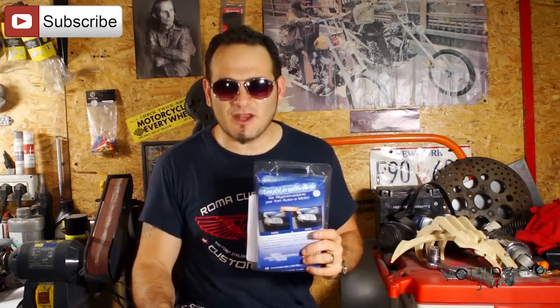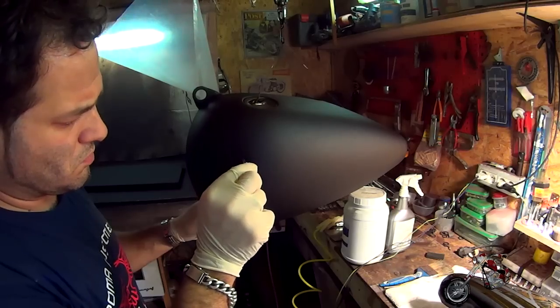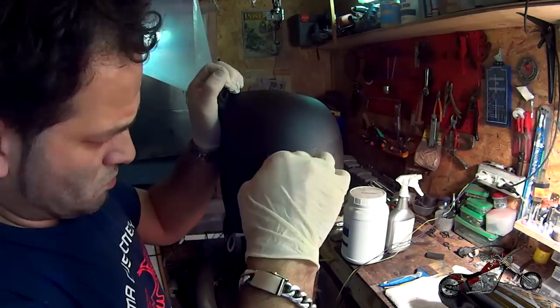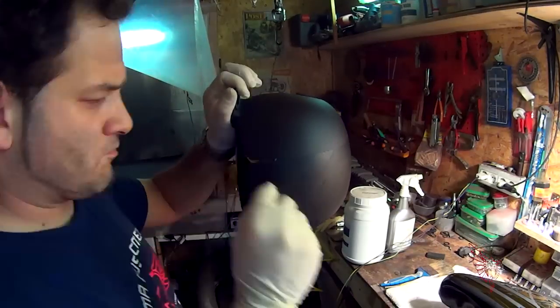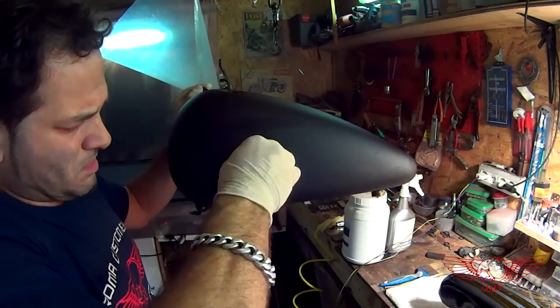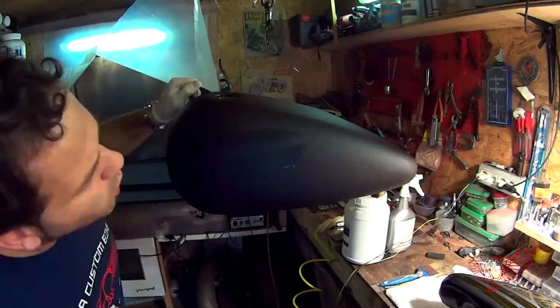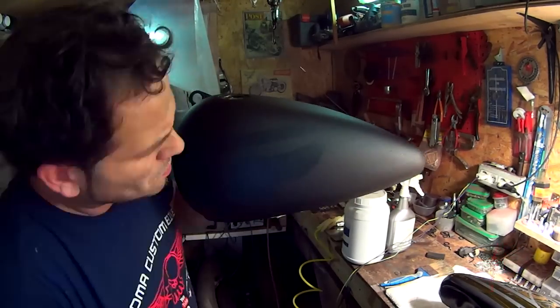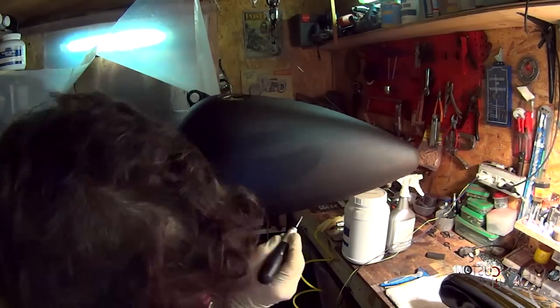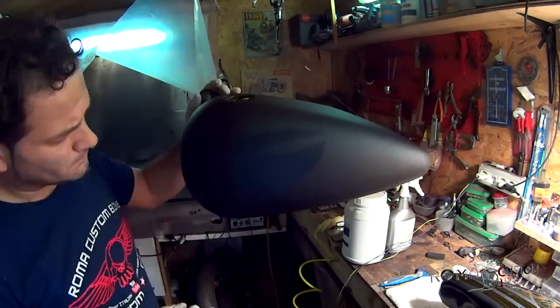Remember to subscribe to this channel so you won't miss it. Now that the tank is cool enough to be touched, let's get back to our powder coating process. I started removing the high temperature tape masking very, very delicately. I immediately noticed that the film of paint over the tape was a bit more brittle than usual — but we'll talk about that later. I'm using latex gloves to avoid leaving fingerprints or skin oils over the paint, since the curing process is not yet done.